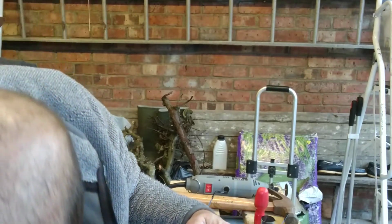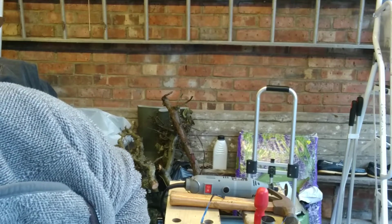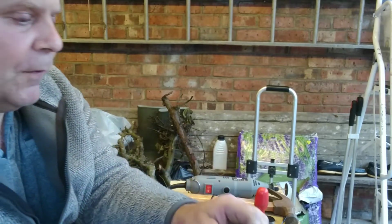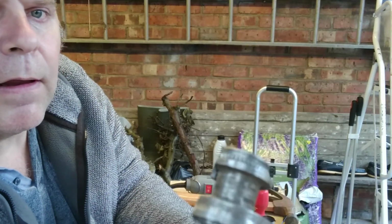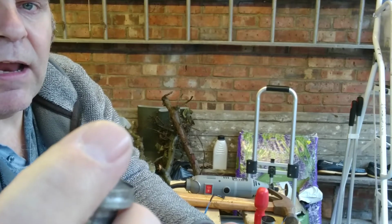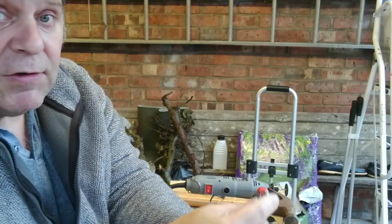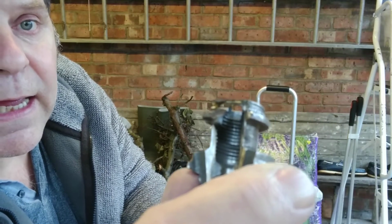And what you have to do is cut it, you have to be a little bit careful, because believe it or not, I was being a little bit careful, not a lot. You can see that this is silver, so you can see if I try and hold it, there, that is all chuck. So where this collar meets the drill is dark metal, high tensile I assume. So try not to drill any of that, or cut any of that. But if you can cut all of that away, which is what I did, and then it just wound off by hand.